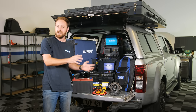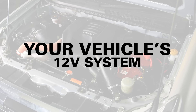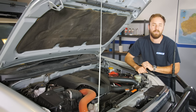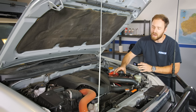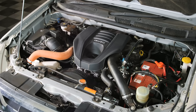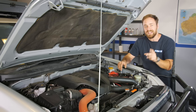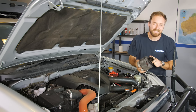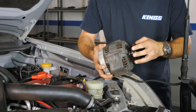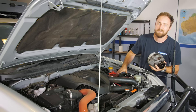Now it might look a bit confusing, but don't worry, I'm going to start right at the start with your starter battery. In most vehicles, your starter battery is located under the bonnet, and it serves a couple of purposes. When you turn the key, it provides the power to start your engine. And while the engine's running, it'll run the computer and injectors, anything that the engine needs to run. It'll also power the fan, radio and all that sort of gear too. To charge this while you're driving, you need an alternator. This is an example of a basic alternator, the sort you'd find on vehicles up until around the mid-2000s. It's belt-driven off the front of the motor, and it's voltage regulated, so it will produce around 14 volts or a little bit more into your battery at all times.